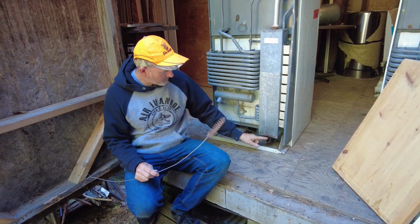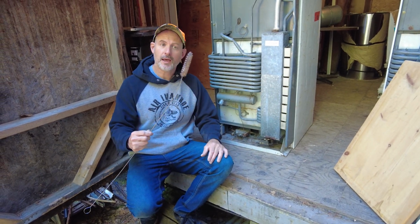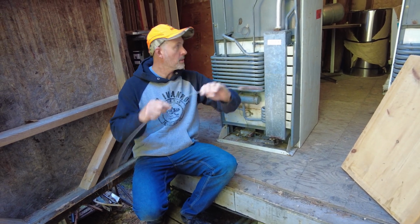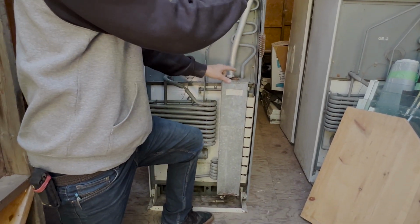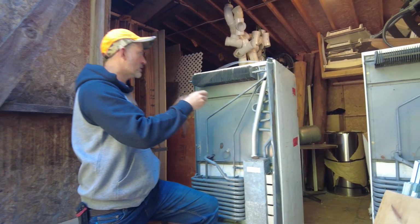Then what happens is it falls directly into the burner, and that's not what you want. So if you are using a nylon brush, you have to wait for this thing to cool down so you don't melt the nylon brush. The other problem with a melted brush is that it doesn't hit the walls anymore. It's almost useless, right? So it needs to be a fairly tight fit in here to make it actually work and to brush this out.